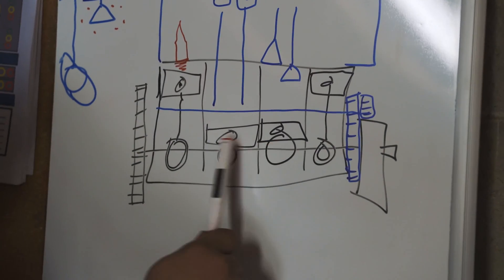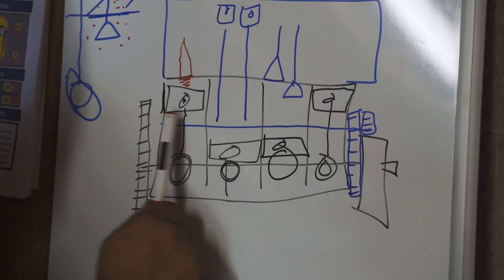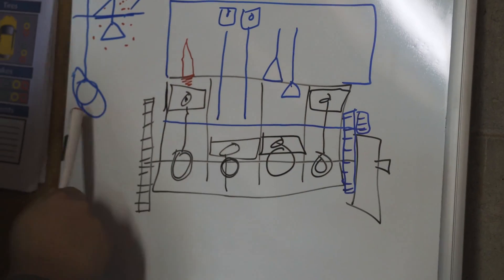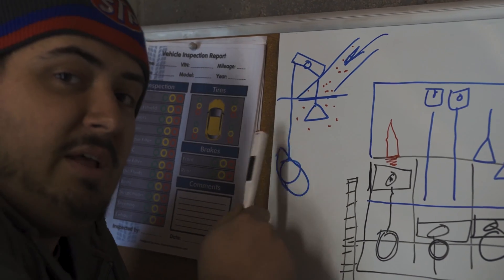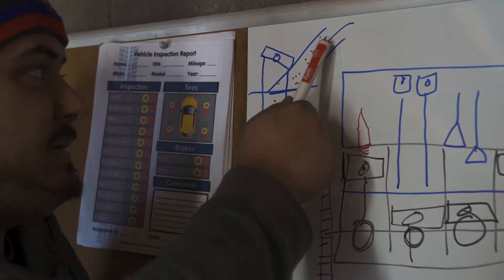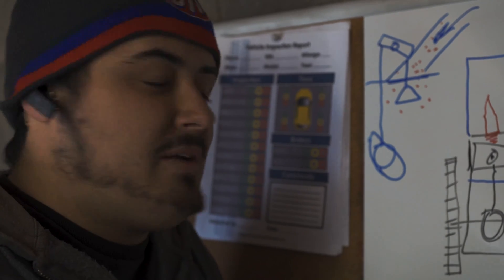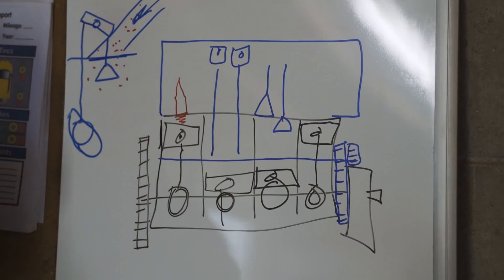So in order to compress — this is our crankshaft here with all of our very crappily drawn pistons, I'm not an artist I'm a technician — we were turning the bolt on the crankshaft which in turn turns the timing chain for this camshaft in blue here, which pushes on push rods that open the valves you were looking at. This over here is a side view of the camshaft design. It's got a lobe on it, and as the lobe goes around the high point will hit the push rod, push it up, and open the valve. The valves you were just looking at were on the intake side — that's how the fuel and air get inside. That timing chain turning the camshaft to open the push rods to open the valves — that is the T in FACTS.